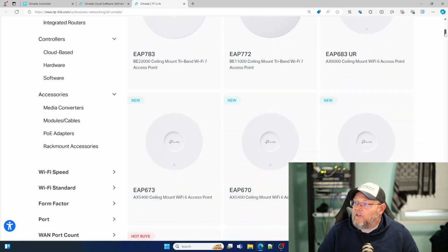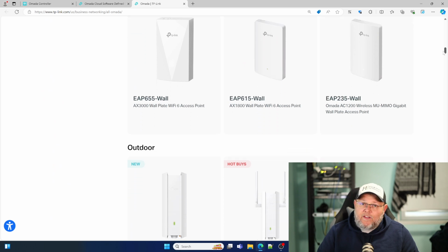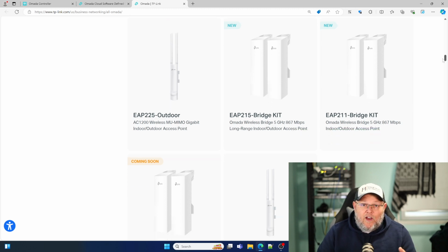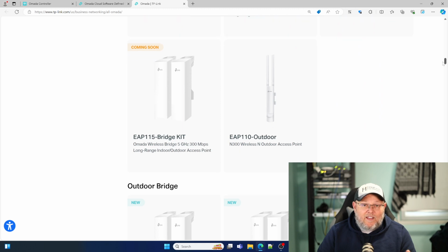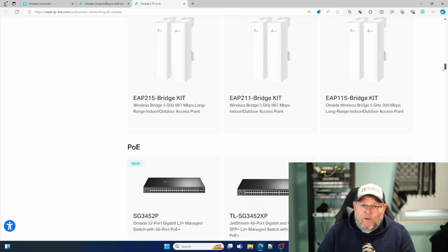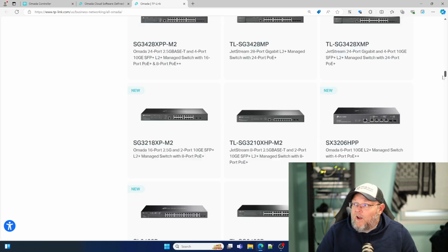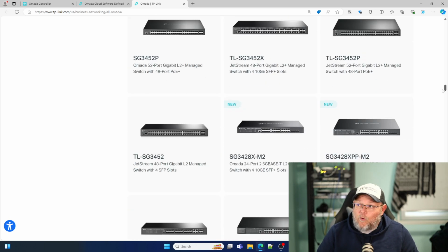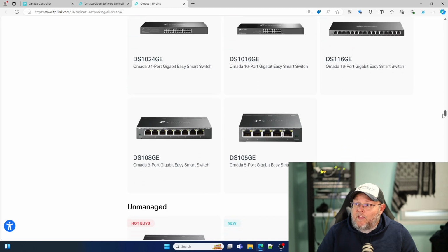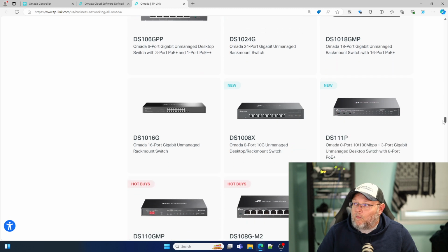Now, I'm not using the newest equipment, but I'm using what I have. And so one thing to know is that TP-Link Omada supports more features than what you're going to see here. For example, if you've got a router that supports it, they do have IDS, IPS, intrusion detection, intrusion prevention. And my router just doesn't have the horsepower, or however you pronounce that, to do it, right? So I do have clients that I work with that have newer routers, and they are able to run IDS, IPS. The bigger routers don't take the speed ding that's noticeable like the smaller ones do.